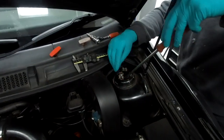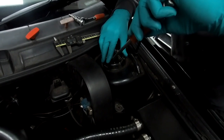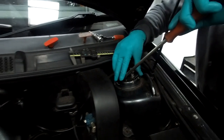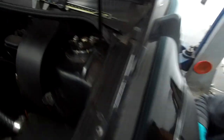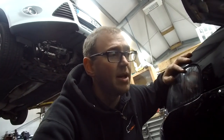Corner weighting's done. We are going to get the alignment gear out. We're just turning the top mounts at the moment — we've got 3.9 degrees currently and we're just rotating these. I'm going to change the slider slightly to try and bring it down to about 3.2. We've turned the top mount, brought it down, put the gauge on. We are at 86.8 degrees, so because it's measured from 90 degrees, that's 3.2 degrees camber. Spot on.